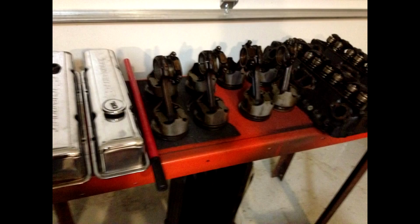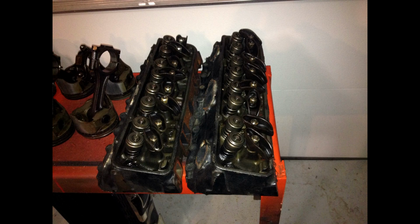Even though they looked to be in good condition, the heads that came on the 1972 small block Chevy 350 engine were not what I wanted for my 383 stroker build. My research showed these heads have a 76cc combustion chamber, which leads to a lower compression ratio. Also, they are a lighter casting and prone to cracks. And most important to me, they have poor airflow.